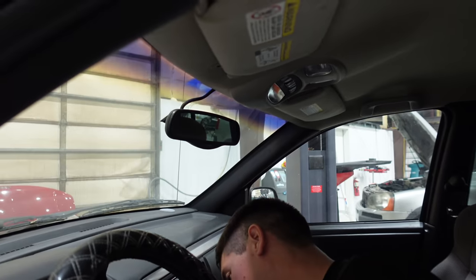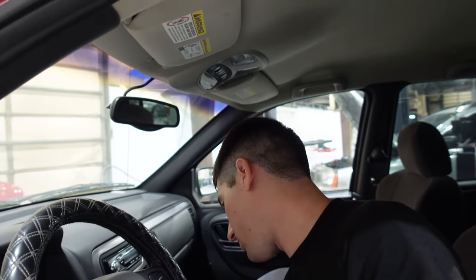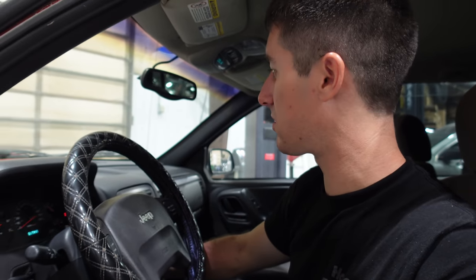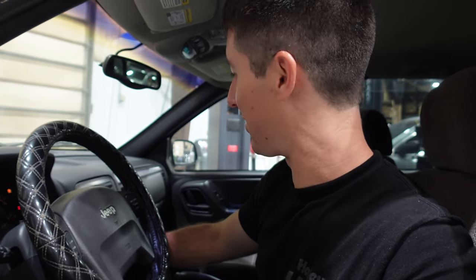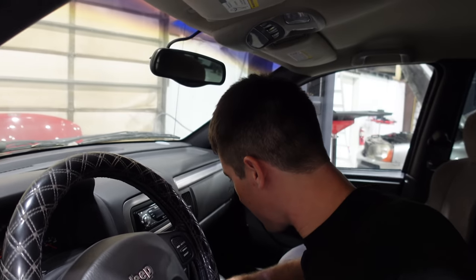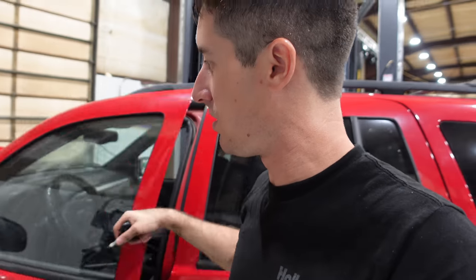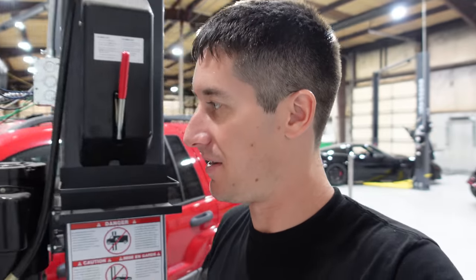This thing sure has a lot of problems. I have a feeling the SKIM issue came from it sitting forever, or from them beating this thing up. The antenna ring looks fine — that picks up the transceiver in the key. We're getting a fuel pump now — and it'll start for two seconds. And it runs great; it wouldn't do that before. I don't think there's any second key in here; I looked in the center console, looked everywhere. If there are two keys you can solve it, but without it you cannot.